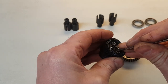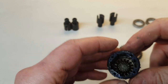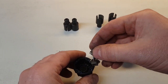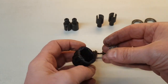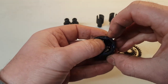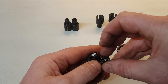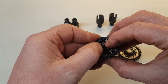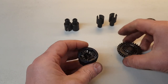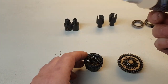We'll remove the gears to inspect them. It probably can't be seen too well on camera, but that looks like very little wear, and the little satellite gears look good too. Since it's pretty much dry I'm not going to degrease it. We've got these small bearing-like pieces which sit in the grooves on the side of the bell housing of the diff. It's a bit fiddly, but they just need to sit in there like that — and there is our other gear.